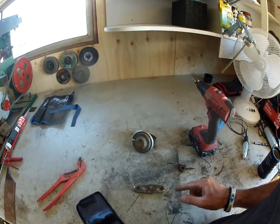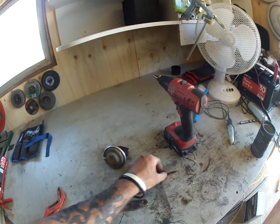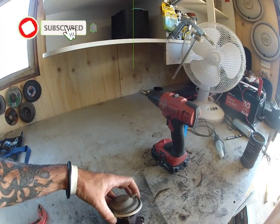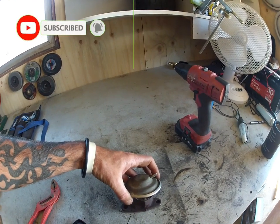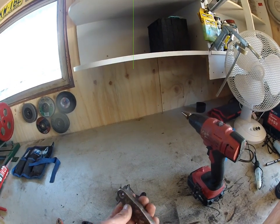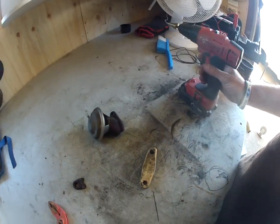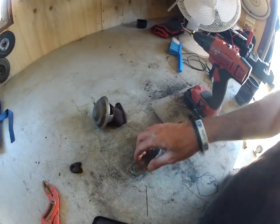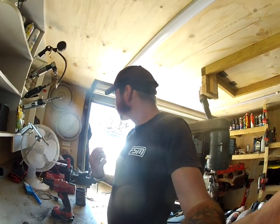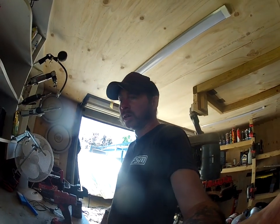Alright, so I've got the plate made up, as you can see. Bigger hole, smaller hole. So it all goes accordingly, like that. So now what I'll do is I'll just deburr these holes. I like to just use a step drill and just give it a quick once over. Don't enlarge it too much, just make sure you take the burr off, and then I'll paint it up and we'll see if it fits on the Lada.